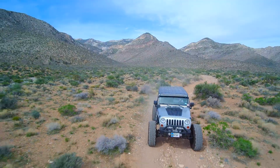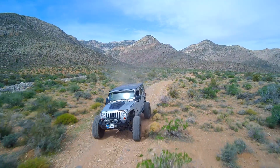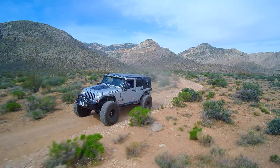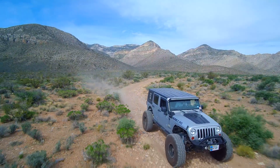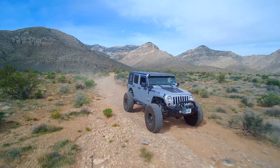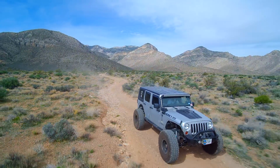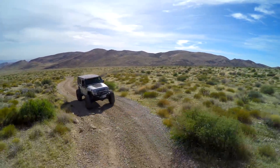Plus or minus five is actually really good; plus or minus ten is very acceptable. When you fill up and go to a different grade of fuel, those fuel trims are going to change. If you go from sea level and climb a mountain to five or six thousand feet, the barometric pressure changes quite a bit, and that again is going to change your fuel trims, as is temperature. If you go from 70 degrees to 105 degrees in the same drive, you're going to see those fuel trims constantly trying to keep the oxygen sensors switching at or near stoichiometric when you're in closed loop. Two percent is really good. There's freeze frame data, so you can look at what happened when the event happened — let's say it threw a check engine light.